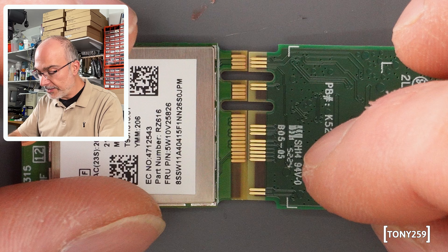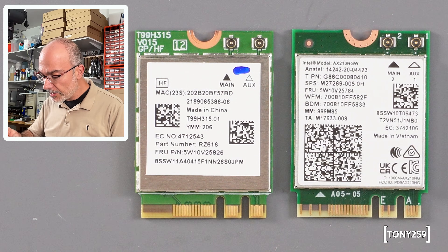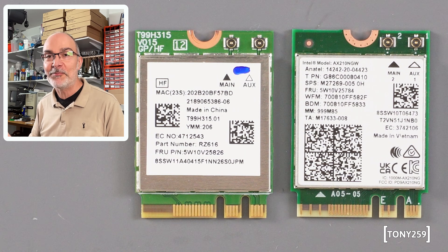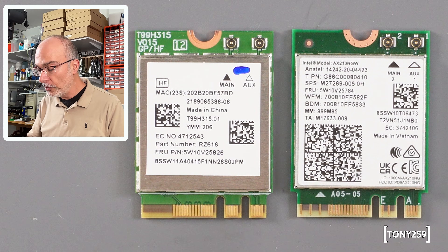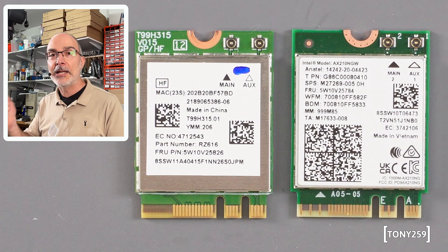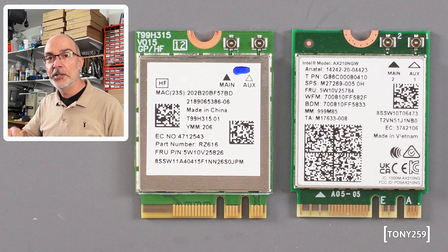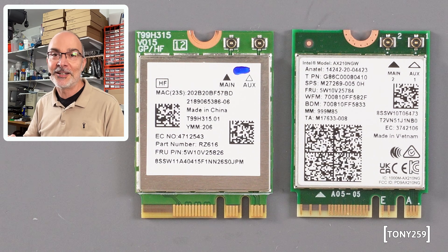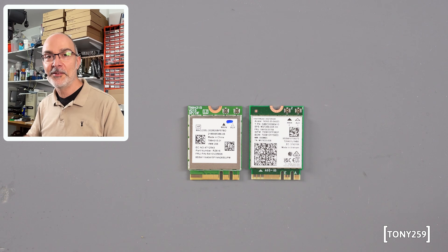The key is absolutely identical, so let's compare these cards side by side. All I can see is that the actual pins being used on the connector are different between the two cards. I can only hope that the worst that can happen is it just doesn't work and doesn't damage anything. What I'm going to do is install this Wi-Fi card but not the aerials — they're fragile and I don't like to plug them in and out unnecessarily. I'll plug in the card, secure it with the screw, close the lid, turn on the laptop and make sure the card is being detected first. If it's not detected, there's no point plugging the aerial in, so I'm saving an extra insertion cycle on that fragile connector. Let's install the Intel card.